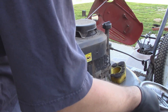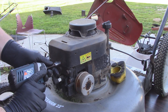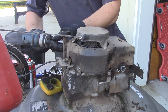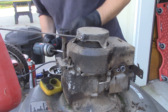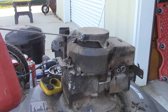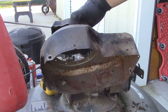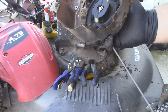To remove your starter recoil there are a few bolts to take off but nothing too major — the good thing is all the bolts are the same size. You have one up here, another one back here, and two quarter-inch bolts holding the dipstick tube on. What I normally do is flip the tube around to get it out of the way but let it remain in place. Black Widow check — not seeing anything too outlandish. Let's go ahead and pull this off the mower. Replacing pull cords is something a lot of people do different ways — I've always done it this way and never had an issue.